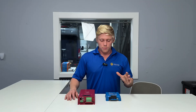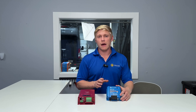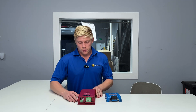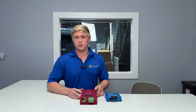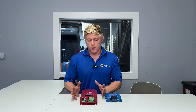Starting with basic specs: the Orion XS is a 50 amp charger with 12 volt input and 12 volt output only, so it only works if you have a 12 volt vehicle and a 12 volt house battery. Victron does say they're coming out with a 24 volt version next year. The Sterling is a 70 amp charger with 12 volt input and 12 volt output, but they also have models ranging from 40 amps all the way up to 200 amps, and models that work for 12, 24, and 48 volt house batteries — so they pretty much have a model for every application.